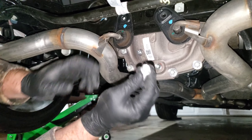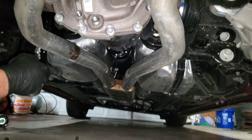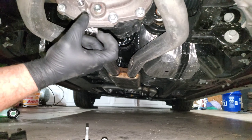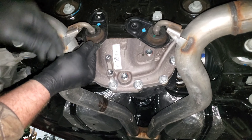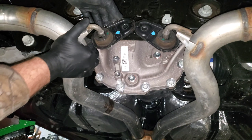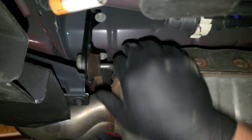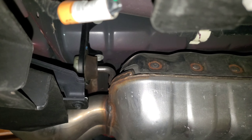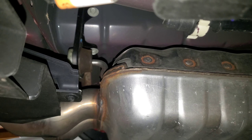Alright guys, what we got here is two 13mm bolts to hold these hangers on. Now there's four 15mm band exhaust clamps up front — we'll show you those in a minute when we put the exhaust back in. Literally lift up, pull back, and this exhaust is loose except for these hangers right here — one here, one over there on the other side. We literally jiggle it loose, pull back, and pull the exhaust out from the front and drop it.